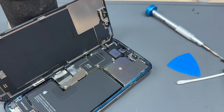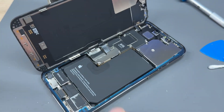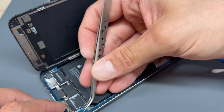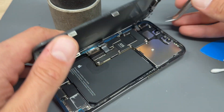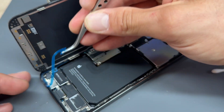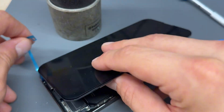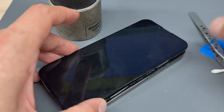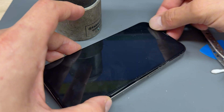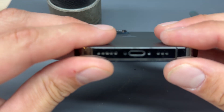I've got a real greasy fingerprint on there — I didn't have greasy fingers until I touched that phone. Let me remove the fingerprints and then lift off the final layer of blue film on the adhesive around the edges. Be careful when pulling that off because it has a tendency to bring the adhesive with it — if that happens, just run your tweezers or plastic spudger over it again. Fold the screen down, peel off the last of the film, and make sure it goes in the top first, nice and flat. Push it down along these edges and the bottom — just push it down and squeeze it in.